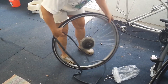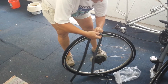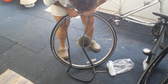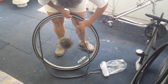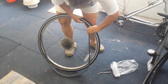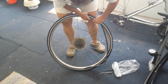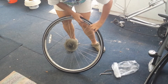So you find your tube — your old tube — and put it in the hole for the tube and tuck it in. Make sure it's not twisted because it won't fill up with air correctly. Just feed it in, making sure that it's over the edge and not twisted or bundled up. You can do that without any tools again — this is a very easy job without tools.